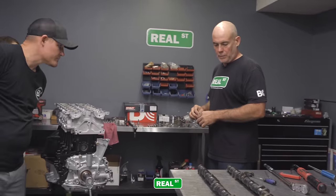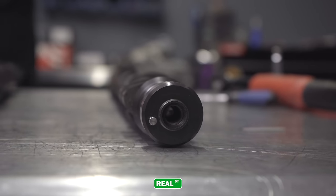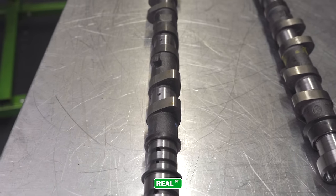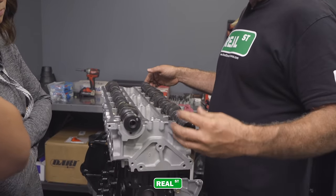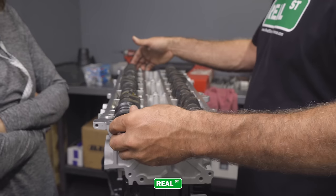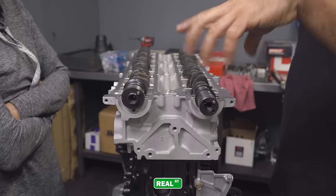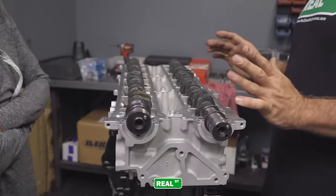Now we can put the camshafts in the cylinder head. And obviously, I'm guessing since this one's got a longer snout, this will be the one with the VVT-i cam gear. So you put these in, and you have the cam pins. This pin is going to locate where this is, because this all gets timed. If this is out of time, you can make a real mess. So I'll put them over at 1 or 2 o'clock. And then I can bolt the camshafts down to the cylinder head, and then I can work on timing the engine. Right.